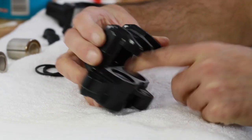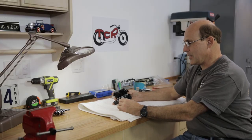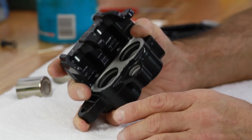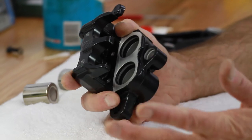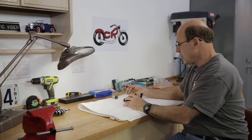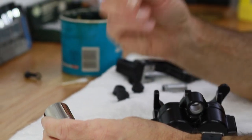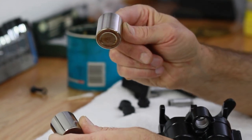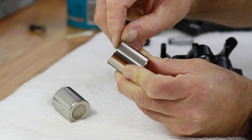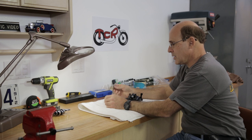One thing I need to say right now is don't go using old o-rings when you rebuild these. They may come out and look fine, but do it right from the start — get new ones. Now I'm going to say the same thing about pistons. If the pistons look good you can reuse them, but if they're pitted or rusty, especially on the top quarter inch or so where they've been sticking out for years, don't spare the expense — get new ones. These are your brakes.